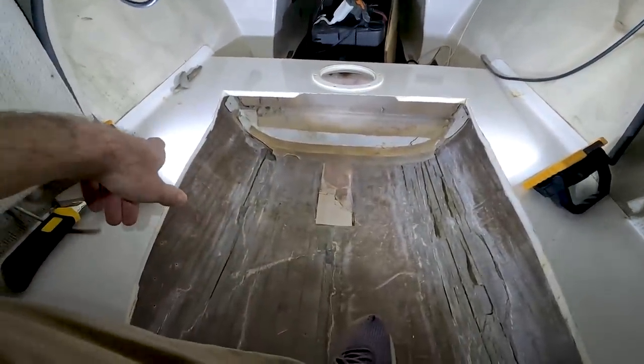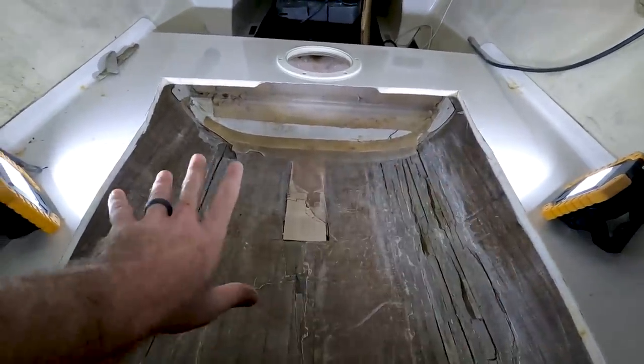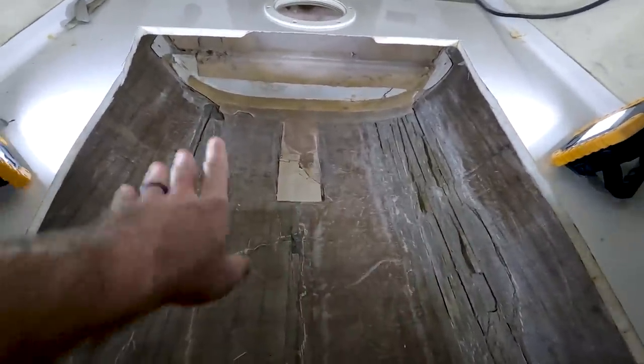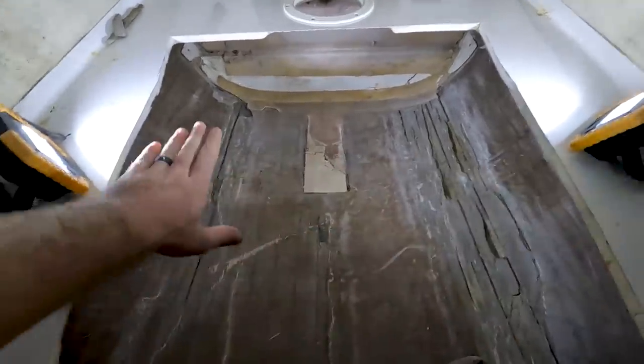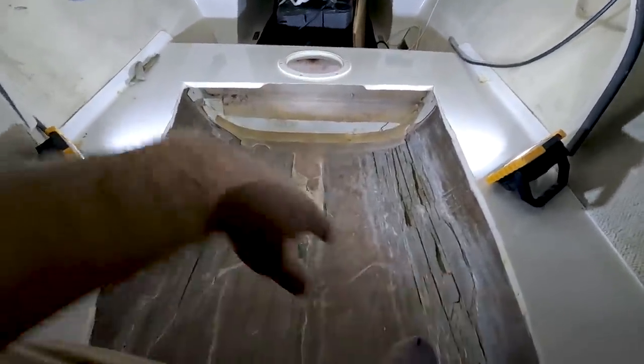All right, guys. So what I think I'm going to do is I have to wipe everything down. Obviously, I haven't done that yet. Basically, because I need to sit here to glass that area, I can't really clean this area because as soon as I clean it, I'm just going to dirty it up again by sitting on it. So I'm going to lay this stuff up in sections. I'm going to lay this part up here, clean it, lay it up. The fabric's going to stop right here. Because I have a bunch of working time with this epoxy, I'm going to leave that part laid up, but then from up there, I could lay the part that I'm sitting on up. With this part half laid up, I would have to clean this area, lay up the glass, and then put peel ply over the whole thing. It's too awkward for me to access this area from up there or even from in there. So I think this is how I'm going to do it.